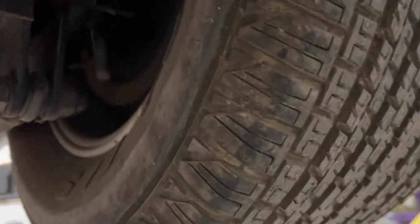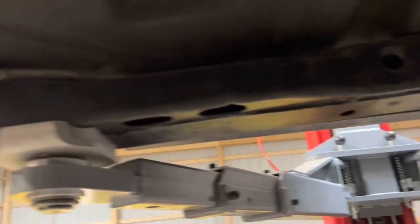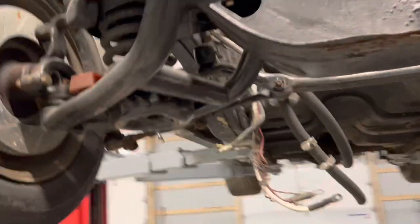So here's probably where they sit. Look at that fuel line. That one's got 52 different ants and everything else living up in that line there. So I'll just take all this out. It's not about losing half inch lines right now. I'll just take all the old ones off. See if I can't talk him into doing some braided line all the way up to the front. We'll do 8 or 10 up to the front, one for fuel and one for the nitrous side, obviously. We're gonna keep the power steering, power brakes, so this way when he wants to drive it too, he can with the hand control.